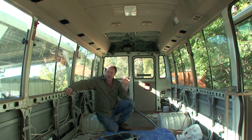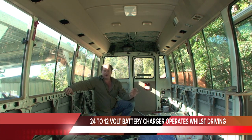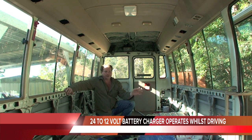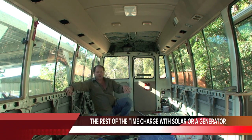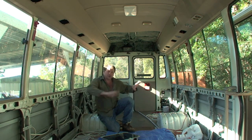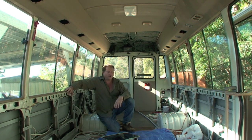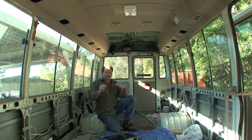What I'm doing in this vehicle — which is now considered the way to go and is easy enough for anyone — is to put in what's called a 24 to 12 volt battery charger. They're anywhere from $350 up to $560. You wire straight into your 24 volt outputs, it's very simple to do, and then you're connected into your 12 volt battery or both 12 volt batteries if you have one or two additional house or secondary batteries. Those are the batteries you operate everything off, giving you a 12 volt system.